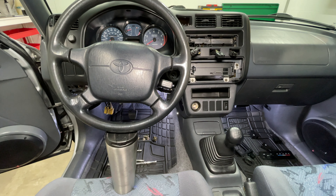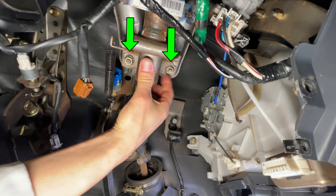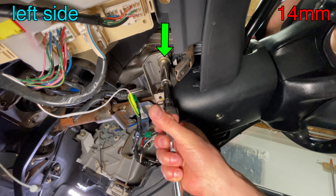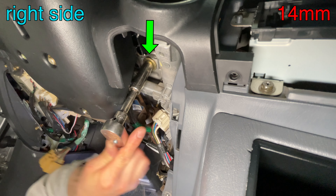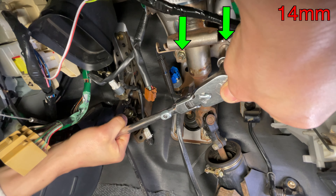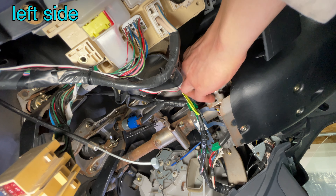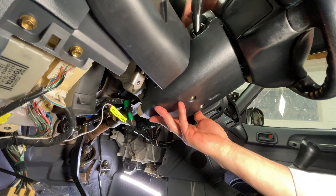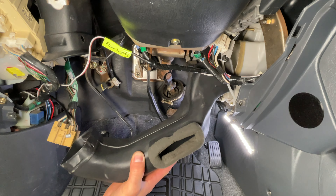Use a coffee mug to support the steering wheel. Push the front steering column bracket onto the studs and thread the two nuts all the way on by hand. Install the left bolt first — it's easier to reach than the right side. Use a socket to spin the bolt on but don't tighten it yet. Push the trim out of the way and thread in the right side bolt using a socket with an extension. Make sure the steering column is straight and tighten the bolt. Remember to tighten the left side bolt and the two nuts holding the steering column. Plug in the brake switch. Reinstall the metal bracket covering the left steering column bolt and use a 10mm socket to tighten it. Push the lower column trim up to snap it together with the upper piece and reinstall the small Phillips head bolt. The plastic vent duct goes in next.